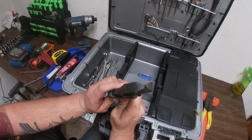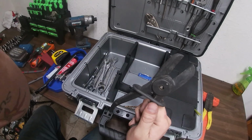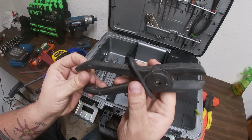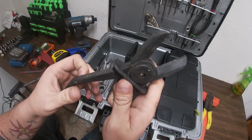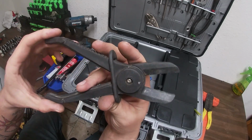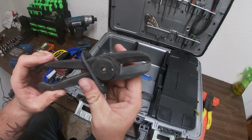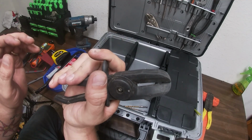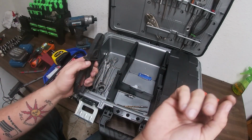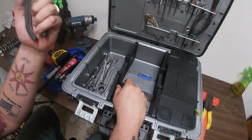This is an important tool that gets overlooked, and even though this is just a piece of plastic, even at Harbor Freight, I paid $27 for a set of 3 of these. These are fuel line clamp pliers, which are useful because most of the time, if they don't have a petcock or the petcock is on the carburetor, it's going to be leaking gas, especially on Hondas. So you want to get in there with fuel clamp pliers, clamp them down, stop the gas flow. Or you can do that little trick where you put a screw in there, but it's never perfectly sealed. So yeah,